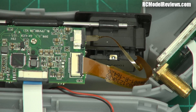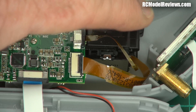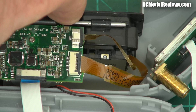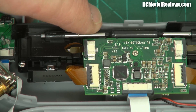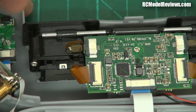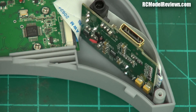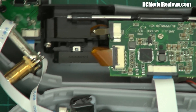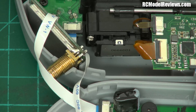Let's move across to the optics and the mechanics. There's a lot of flat flex cable here, but when you've got bits that move like the lenses for the IPD adjustments, you've got to have something that's going to flex and not break over time — flat flex is flat and flexible, so that seems to work okay. There doesn't seem to be that spring-back anymore on this lens now that the top is off. So I wonder if a piece of flat flex has got trapped. This side seems okay and free enough. Maybe something was wrong with the way it was assembled, because this piece of cable on the end has been totally munted by the assembly process. We've got a couple of 5.8 GHz receivers — one here and another one on the other side because this has got receiver diversity. The flat flex going left, right and center — you have to be careful when putting it back together. Obviously when they put it together, they were not careful. That was half the trouble.